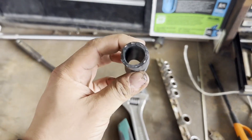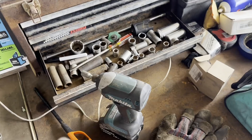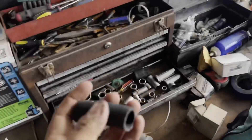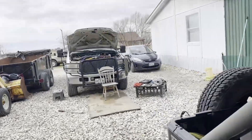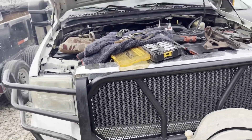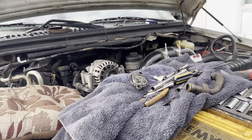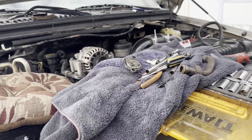I got some pretty good heater hose that I think should hold up — rated 3.4 bar, which works out to about 50 psi. I don't expect it to see 50 psi unless I have a head gasket problem, which I really hope I don't. We're going to go ahead and get this put back on, then start putting the truck back together, go get some coolant, fill her up, bleed her out, and hopefully that should be the end of our troubles. I hate that it's taking me three days to fix this, but I have to go to work and make money. My little surprise is somewhere over there — I'll show you as soon as I get done with this, so let's get her back on the road.